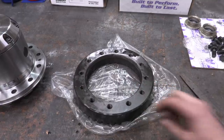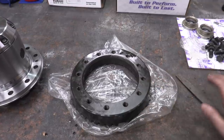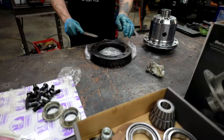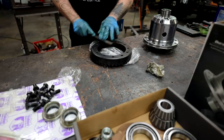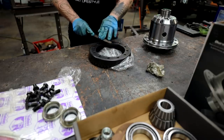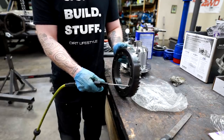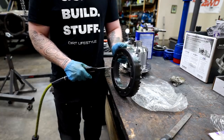If there's a really big discrepancy, we should be able to see it by just polishing up the surface with a flat edge like a file. After stripping all the oil off this gear, I run the file as flat as possible, very lightly across the back of the gear, looking for any high spots, any dings from being thrown in a pile, or even just a burr from the machining process. A lot of times you can just use the file to flatten that out.